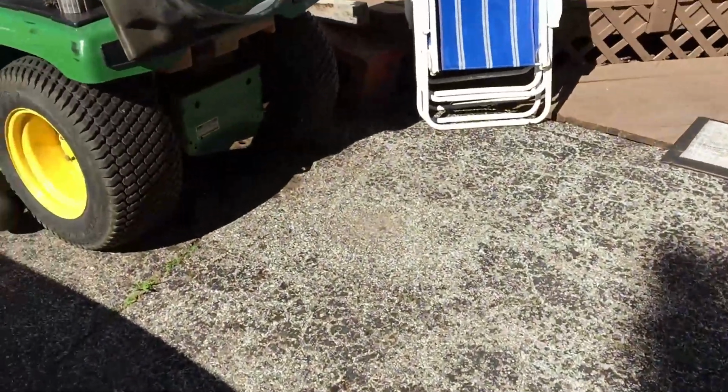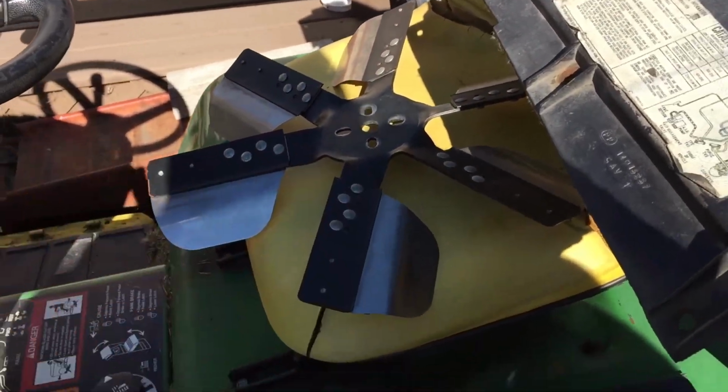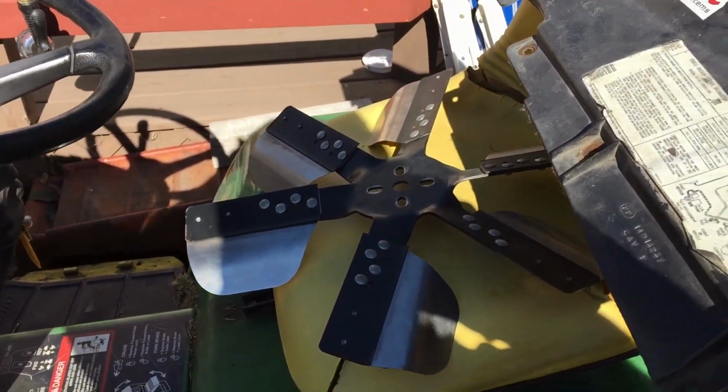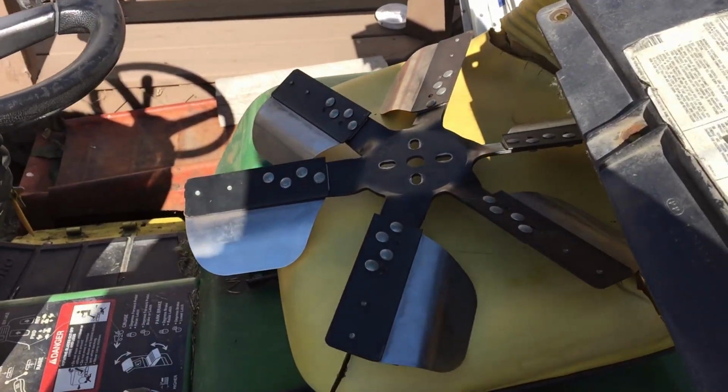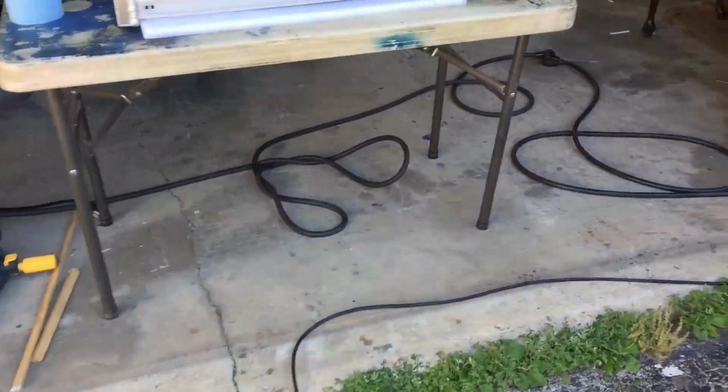But yeah, like I said, we got all of his other stuff off here. Sorry for the glare. But yeah, these mechanical fans, I guess you would call them, it ain't a clutch fan. They rob quite a bit of power. If you guys watch Engine Masters with David Freiberger and them guys, they actually did a shootout on fans, on all types of different fans. And that fan right there was 35 or 45 horsepower, I can't remember which, but I know it was way up there. It was how much horsepower that thing was robbing by running that mechanical fan on there.